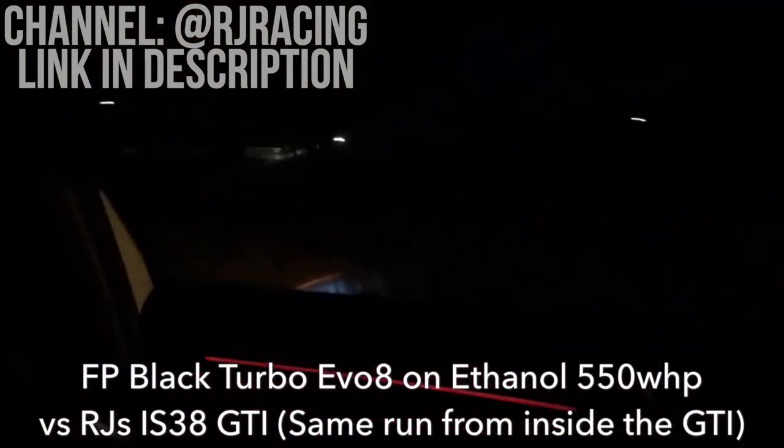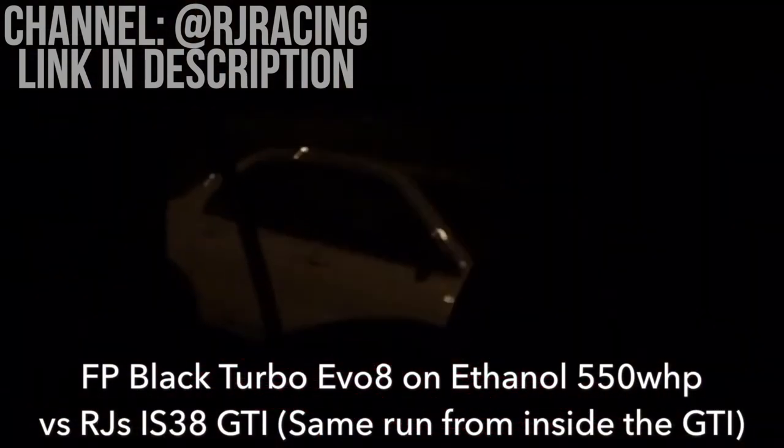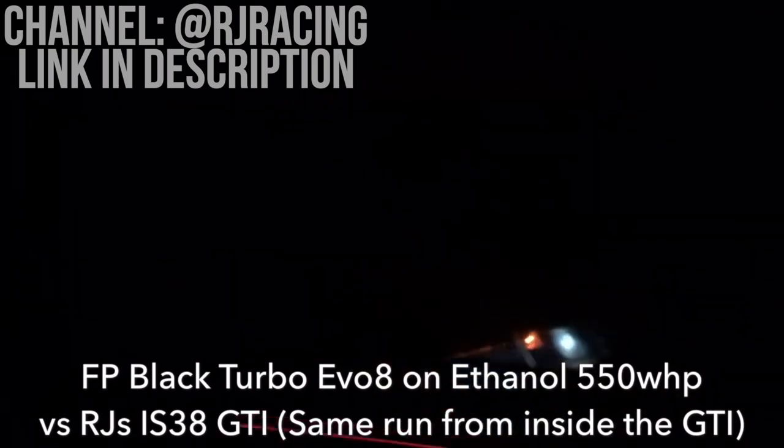Oh shit! This is unbelievable! Holy shit! Another thing I really like is that it offers a Bluetooth kit for the JB4. What it does is connect your phone via Bluetooth to the JB4, and then you can monitor a bunch of different vehicle measurements — for example, boost, RPM, oil temperature, air-fuel ratio, and a bunch of different measurements. You can even update the firmware and change maps all through your phone.